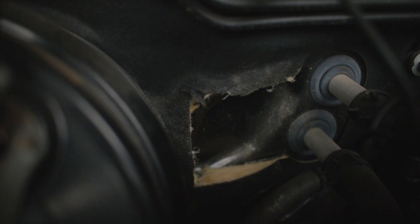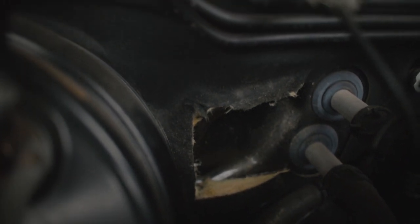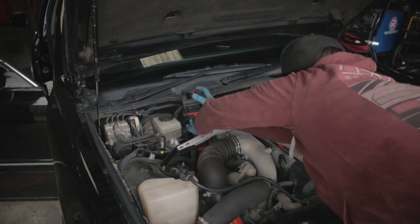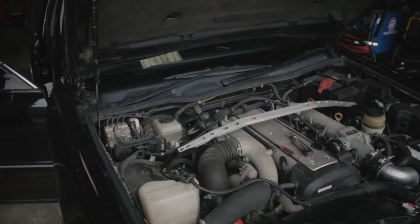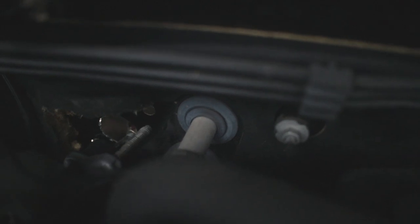Definitely wanted it a bit neater but I don't think I can. This is literally how much you have to cut out to fit the whole bracket assembly. You can see this is the provision to mount the pedal and drill the holes. The top hole that had the parking brake is a little bit off-center so it actually doesn't get used. I'm going to drill the holes and make a little template from the pedal or even from the master cylinder. I'll drill from here, and then once everything is in place I'll add a little spot weld at the top just to help it stay steady.